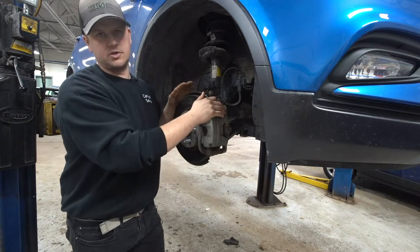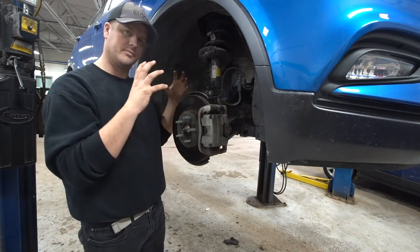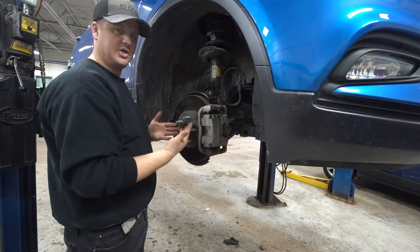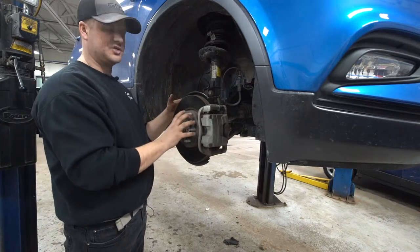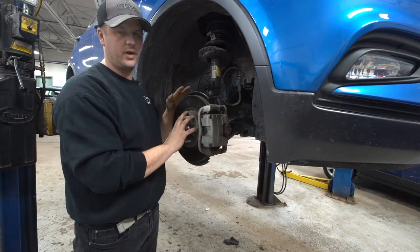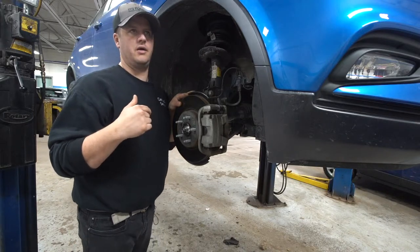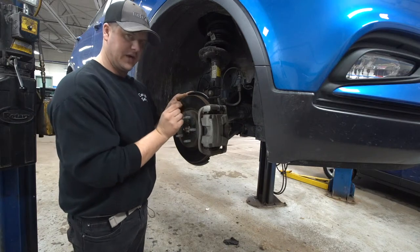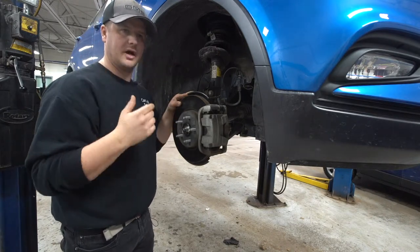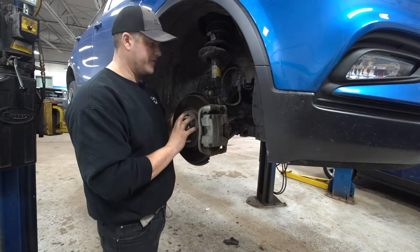The main issues we see with ABS brakes are usually the wheel speed sensors or the hub bearings — sometimes they're separate, meaning you can replace just the sensor or just the bearing, but on some vehicles the sensor and bearing come together as one unit. One fault is that the magnetic ring on the back of the wheel hub can become brittle over time and a small piece of magnet falls off. That creates a gap in the digital signal pattern, which the computer reads as a locked wheel, triggering a fault.